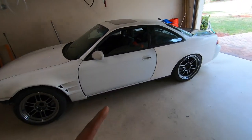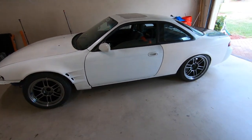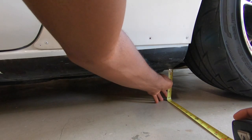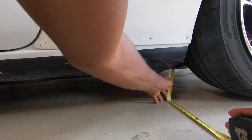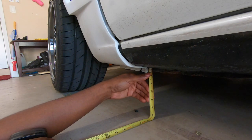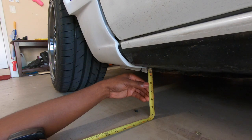I mentioned in my last video I need to raise the back. I'm going to quickly measure the side skirt area and make sure the car is actually higher on the front than the back, because I don't want it leaning forward when I raise the back half an inch. That's looking like five and a half. Off that, the car is close to six and a half. So that's good and bad — I have a one-inch jacking effect. If I do the front one inch and the back one inch it keeps everything with a one-inch jacking point and the car would be higher up, but since the fronts are maxed I have to do one inch or maybe just half an inch in the rear — we'll still keep half an inch of jacking, so that would work out actually.